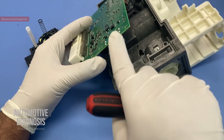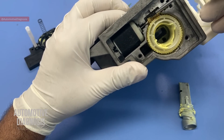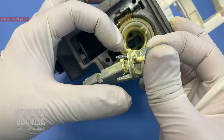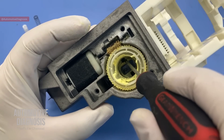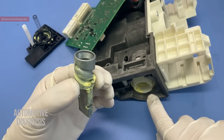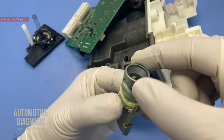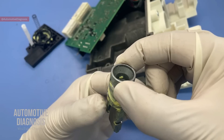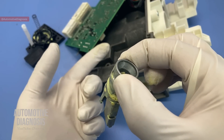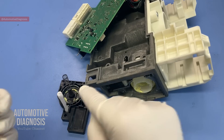Based on the current condition, the start-stop unit provides positive and negative to this DC motor. When the motor operates it rotates the worm gear, and that worm gear is connected to this gear. Rotation of this gear transfers to this part, but this part cannot rotate because it has two sections that sit in fixed holes. As a result, because it doesn't rotate, it can only move up and down inside the gear. So when the gear rotates, this part moves up to unlock the steering lock, and when the ignition is turned off and the system needs to lock the steering wheel, the gear rotates in the opposite direction and this part travels down.